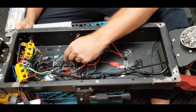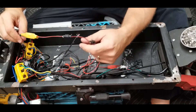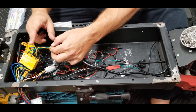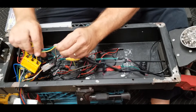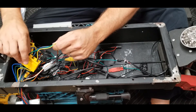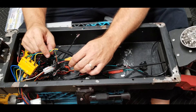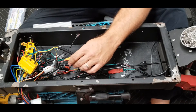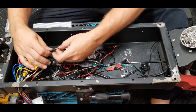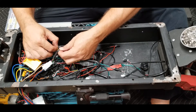Going back to the wiring: most of these DC motors are color-coded the same with yellow, green, and blue — they're three-phase motors. Those wires come directly out of the controller through a distribution power block and go to the motors. In my particular scooter these motors have five hall sensors. Typically, you can tell how many hall sensors you have by counting the wires coming back from the motor — in my case I have five in the front and five in the back.